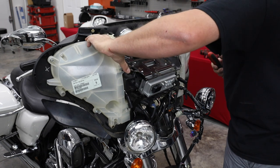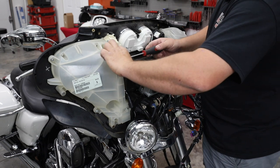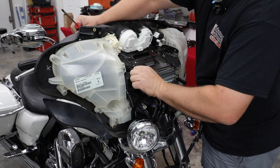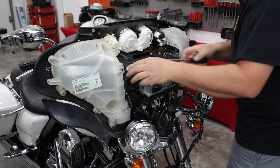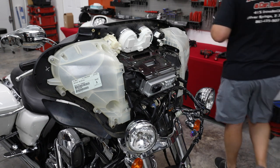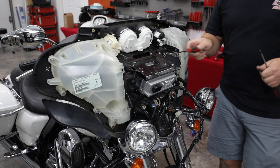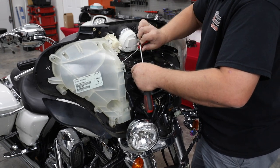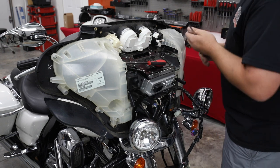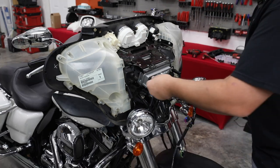And next, we're gonna try to get all of our pod bolts in. It's going to be just a little bit tricky because, again, our fairing is slightly warped because that's what happens over time. And we've got to get all those lined up. These are a little off. Normally, we'll take a small screwdriver and go in one of the holes and kind of pry the pod where it goes. Start the other bolt. That way, we don't end up fighting it too much. All right, so we got those back started.